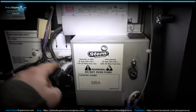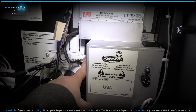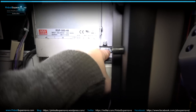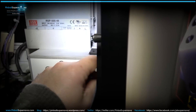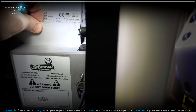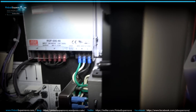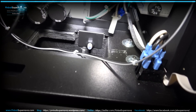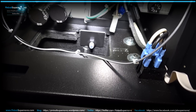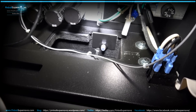On the right-hand side of the cabinet, we need to remove three nuts to reveal the bolts that hold the hinge on. There's a nut here, a nut here, and a nut here. Loosen and hand-tighten them off so the power supply box pops off — you only need to take the two lower ones off, which reveals the nuts at the bottom of the cabinet. Remove those two nuts, and with the one inside the cabinet already removed, the hinge should come off.